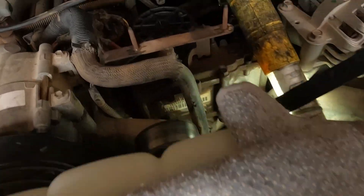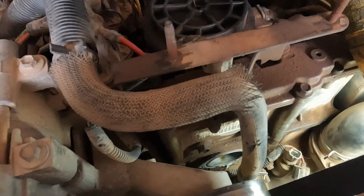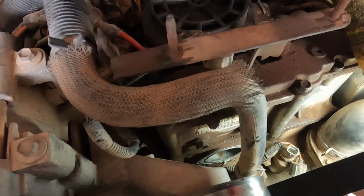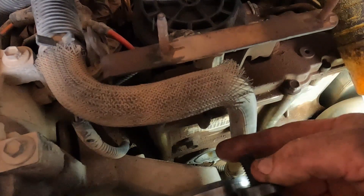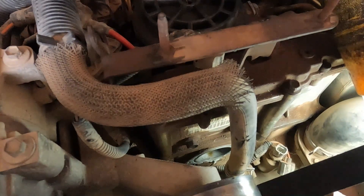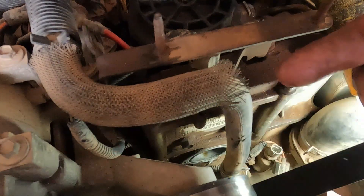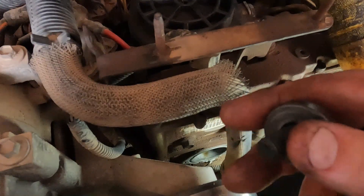The reason you've got to get to this is there is a big bolt that goes inside here. I've already got it out - it's this right here. That slides in that hole down there and that screws into the high pressure pump on the back side. Do yourself a favor: have a magnet on this. You do not want this washer to come off and fall down into the motor. Have a magnet on there as soon as you pull it out so you have something holding this.